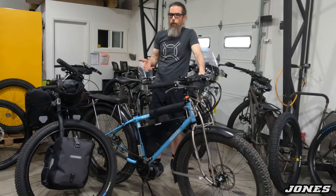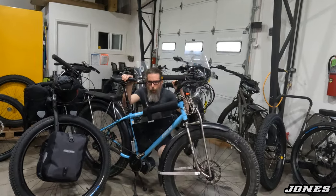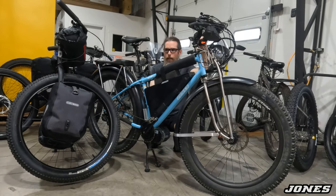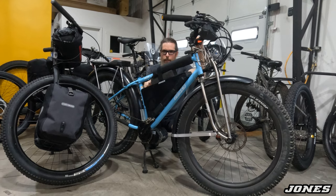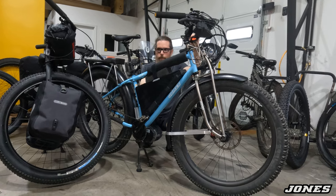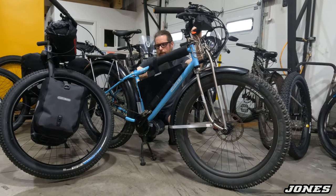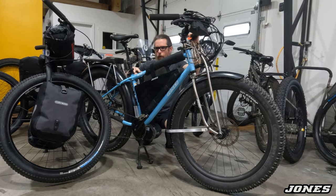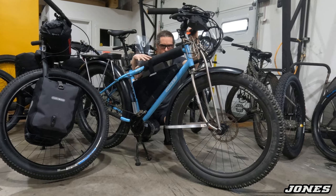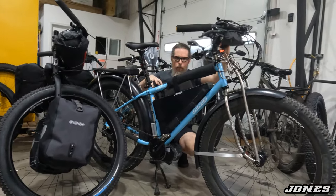I was thinking I'd want a bike to be as light as possible all the time. When I first got this big battery pack, I thought I should put these on only for long rides and small packs on for short rides. But it turned out that if I'm not bunny hopping things, just riding for distance and rough trails, the bigger pack was better. I could ride up and down steeper trails with this lower center of gravity. I had better traction because the extra mass makes the tires absorb things better — where if the bike is light, it can dance across the rocks. With this extra weight, it's just crushed into the ground, rolling and gripping everything.